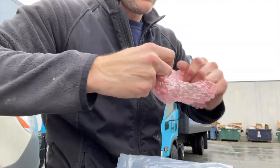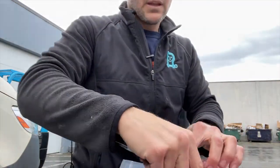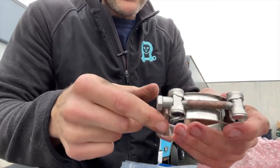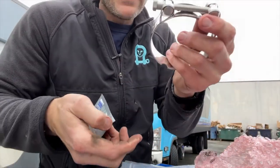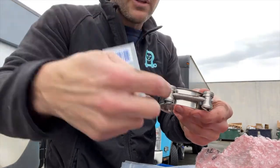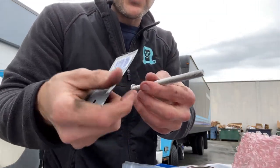In addition to putting it on that bolt that I just had, you're going to pull out these things. And this already has it on it. See that gold or kind of copper looking color? That is anti-seize already on this. If that is not on there, we try to put it on, but if it is not on there already, absolutely put this on the barrel there. Then you're also gonna wanna put it on maybe the last inch or so of this.